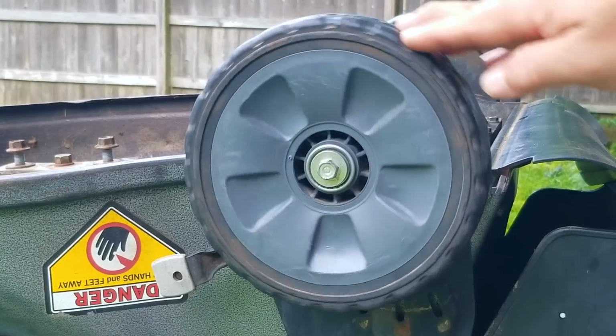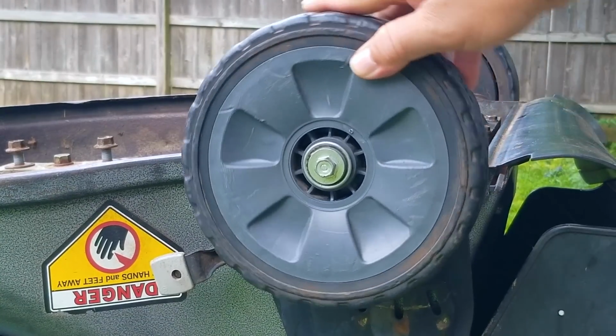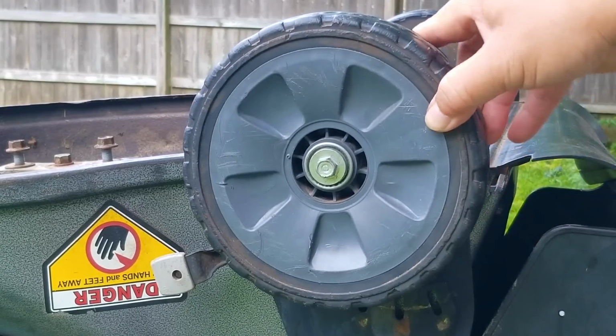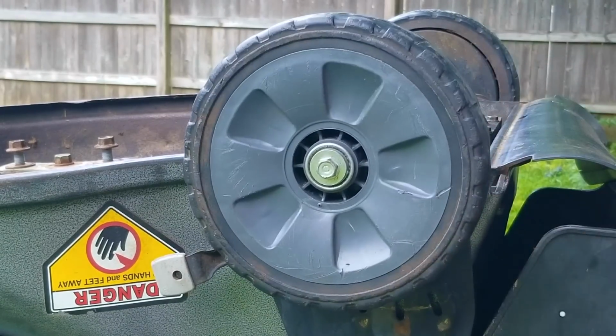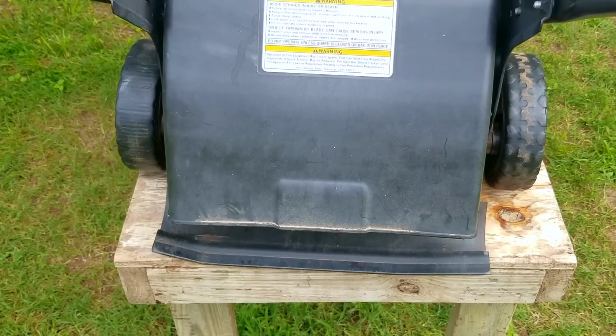Once the wheels have been installed, you can see they can now freewheel in the forward direction, and when turning backwards, they'll spin the transmission just like it's supposed to. Now you're going to know the wheels are freewheeling because you'll be able to hear the key making a clicking noise while the wheels are turning forward. Another reason for the wheels to be able to freewheel is because it allows the wheels to turn independently, making turning a lot easier.